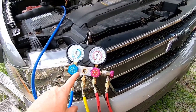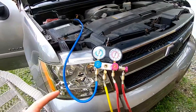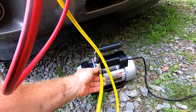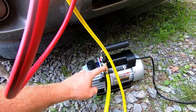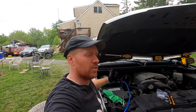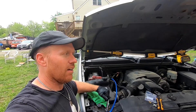If you do have a manifold set, one thing I wanted to add about adding PAG oil — you could either do what I did up here and take your high port off and run suction that way. Or if you're going to be filling it with your R134A, once it's all set, you can take off your vacuum line, pour in the three ounces through there, then attach it to your Freon and that'll suck it right up with your Freon. So there are other ways — you can take this off, pour the oil down into the hose, connect it to your R134A, and charge up your system. You just need to have a vacuum, connect to your low pressure, run vacuum on it, start adding your oil, and it will suck it down in there.